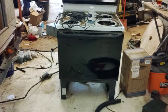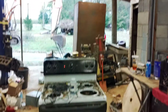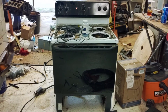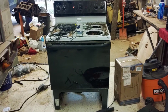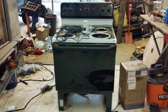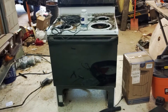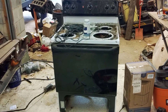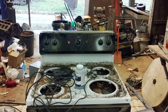I have a large propane oven back there, but for small jobs I use this — just an electric kitchen oven. I can get small control arms, Pitman arms, small fabricated parts in it. It doesn't take up much room and allows me to get the job done quickly. I've removed the eyes out of the top of it because I don't want somebody cooking in it — it's got powder coating residue in it, so this is strictly used for powder coating. I've heated it up to about 475 degrees.